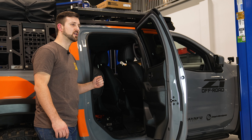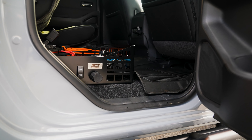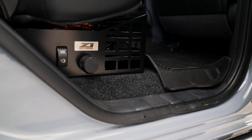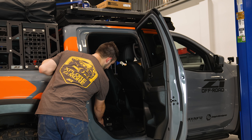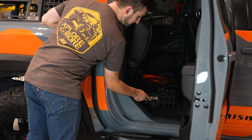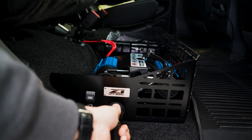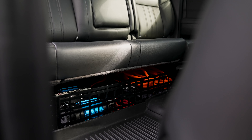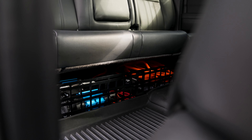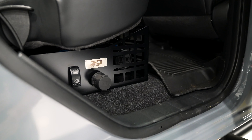The product we have here is the Z1 Off-Road rear seat storage system. It's a molle system — you can store all your molle packs and whatever you want on the sides and front. The most important feature is that it is a home for an onboard air system. We have this hooked up with an ARB twin pump. It has a switch on the side you can activate and a permanent line running from the compressor to the side of the panel with a quick connect mount. You can reach all four tires from this location. It'll fit a single or twin pump — most that are on the market — and it should be compatible with D40 and D41 Frontiers.